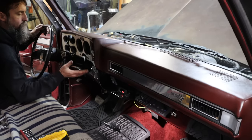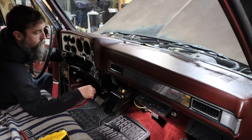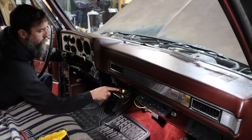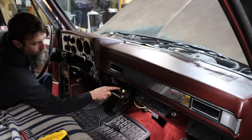It does. It flashes. And it's saying that the temperature for that thermocouple right now is 60 degrees Fahrenheit, and our set point is 192. So I should be able to lower this set point to 60 degrees or 59 degrees, and it should kick on that fan out there. It didn't work. Why is it not working? I heard the relay click.